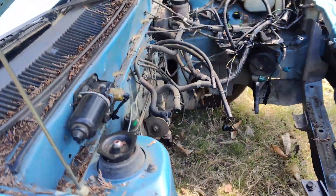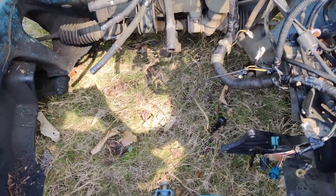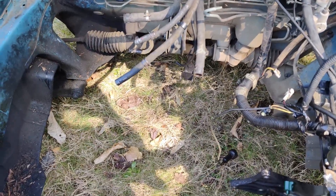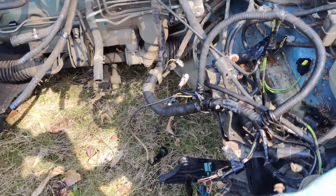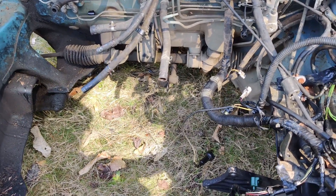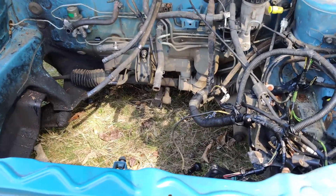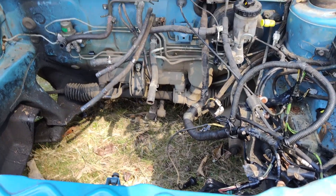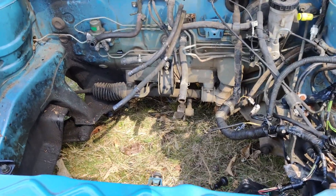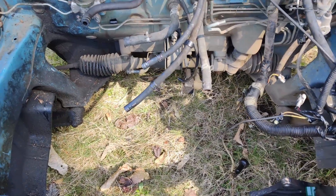The glorious Suzuki G10 three-cylinder has already been removed. I pulled it out and the block is at the machine shop. The thing had 227,000 miles on it and the bearings looked damn near brand new. There's a little bit of wear in the cylinder bores, so we're getting that bored 20 over. This was an XFI, which means it had the more fuel-economy-preferred cam in it, and also only two piston rings per cylinder. Since fuel economy is a secondary goal on this car, I'm going with the standard three-ring pistons from the LSi and other models. I ordered pistons in twenty-thousandths — a half millimeter over. Once those come in, I'll take them to the machine shop and get the block finally bored.